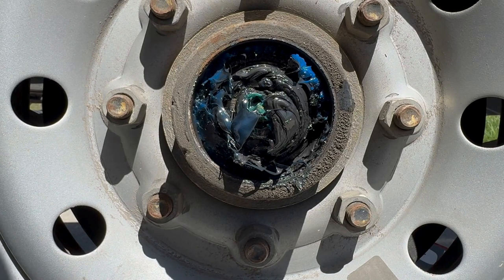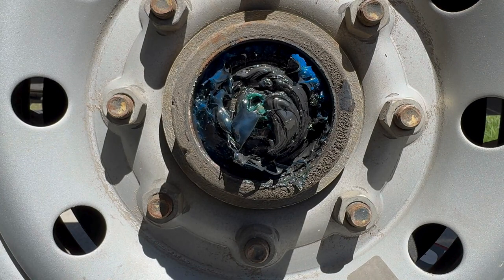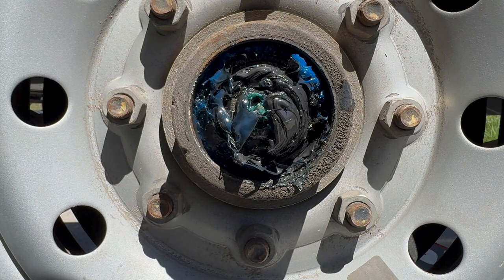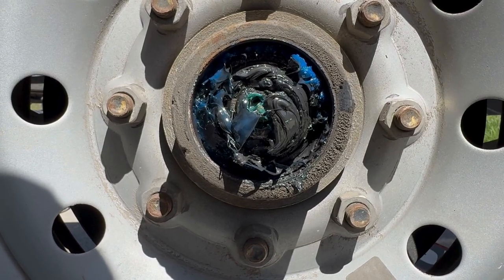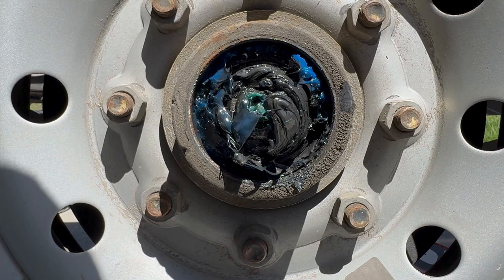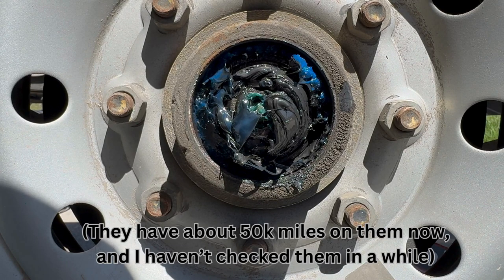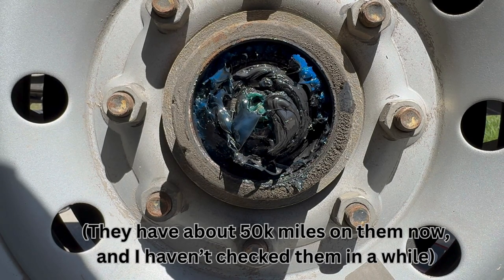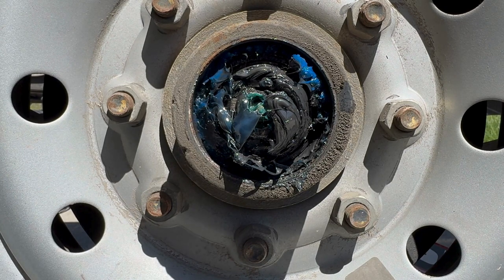I'm going to attempt to show you the little bit of slop that this has back and forth this way. It's going to be a little hard to see on camera, and it's not much, but this is something that can absolutely kill your bearings and your hubs and your spindles if you're not paying attention. When I take hold of each side of the tire and move it back and forth, there's a tiny bit of play in there. These are the factory hubs - I've never done bearings in here, I just keep them greased and check them periodically. I checked today and noticed they all had a little bit of slop, so it's just time to tighten up these castle nuts.